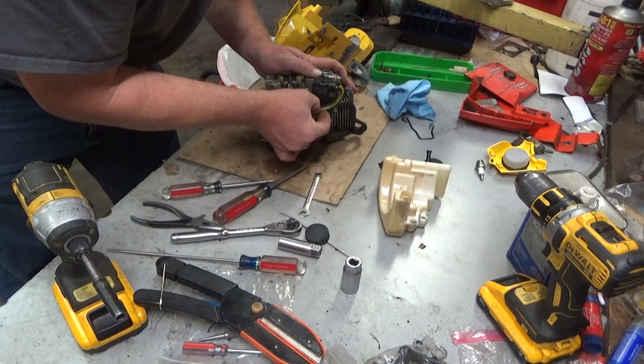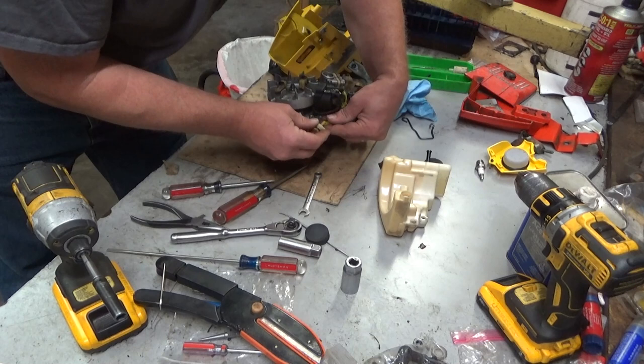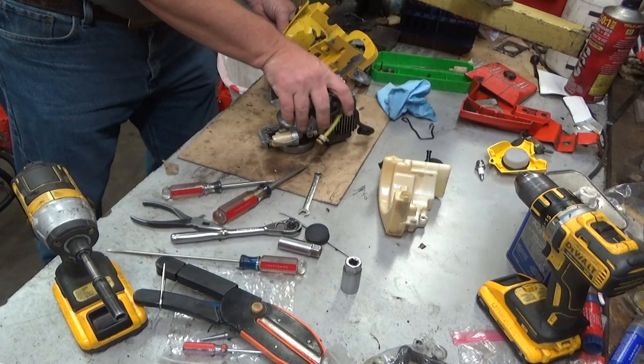I don't remember. I actually think, yeah, you want the fuel hose. If I remember right, the fuel hose should go on the inside of the spark plug lead. At least that's how we're going to do it. Alright, so however your hose lays, try to fit that barb so the retainers pop straight down. That'll just make it easier. And let's see if I've got my stuff together well enough.